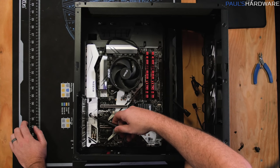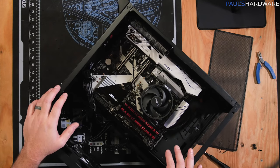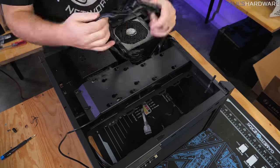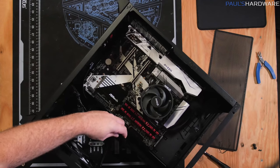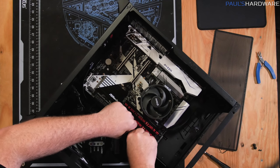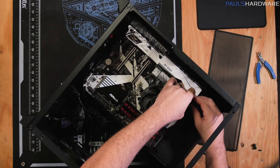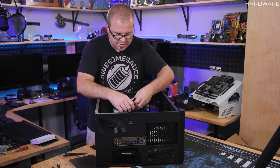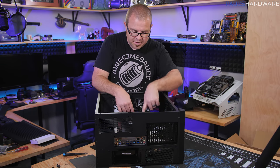This motherboard has one extra standoff point for micro-ATX boards, so there are technically ten; you can add a standoff and screw there but it's not required with all nine standard ones in place. Everything is now installed except the graphics card, which we'll save for last. I've gone behind and done a decent amount of cable management, pushing cables through the grommets to come out in the right locations — for example, the 24-pin main power connector and the 8-pin supplemental CPU power connector.